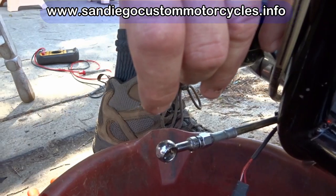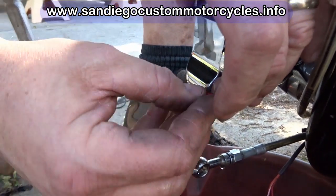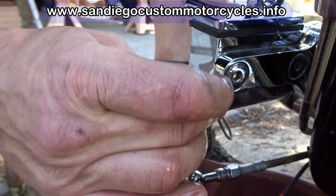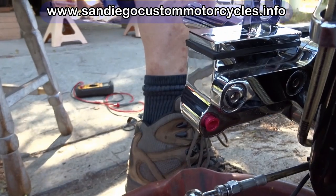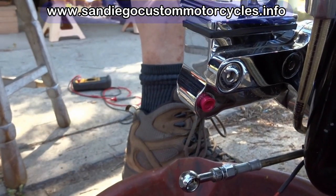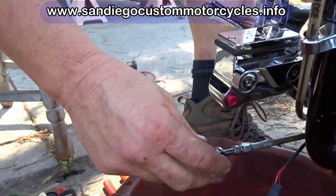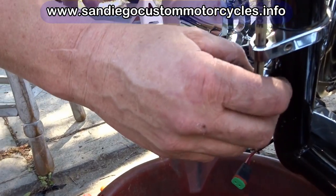Now these bikes, they don't use the regular brake fluid, whatever the DOT. No, normally older bikes and older cars will use DOT 3. These bikes use DOT 5. Just a higher temperature before it boils, is that the difference? That, and it's silicone based. Oh, okay. There's a few different things. The silicone DOT 5 will also not swell seals, whereas DOT 3 will make rubber seals swell.